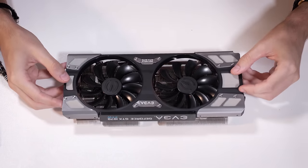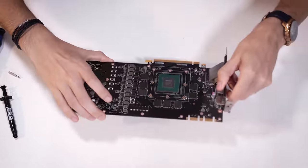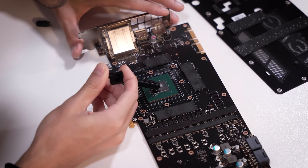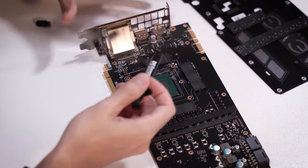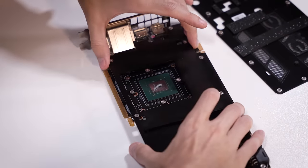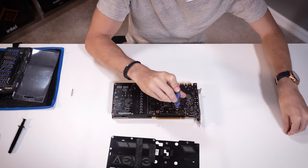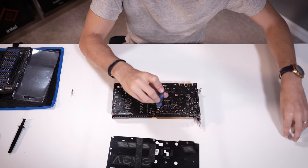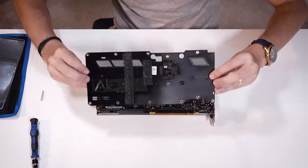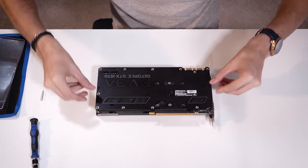We can now merge the heat sink and shroud very carefully — and here we are, a fully reassembled For The Win cooler. Looking nice, but we need to get the PCB together. This will involve some thermal paste, thermal pads, and the two metal plates. I want to overestimate the paste a tad because you want it to spread fully over the die. We'll get this mid-plate back on, take care of the spring-loaded screws, and make sure to cross-tighten these — don't tighten one side all the way or you'll get uneven distribution of thermal paste, which is not good for temps. And finally, the back plate — we've got our remaining thermal pads already on there. Flip this over, set it in place, and a few remaining Phillips screws.